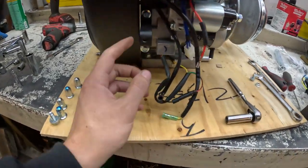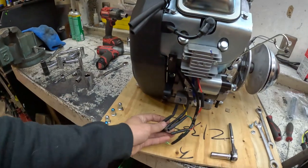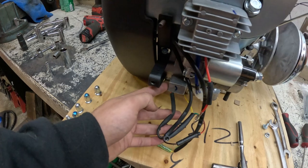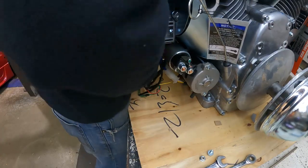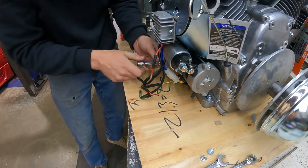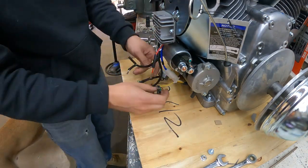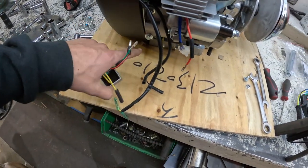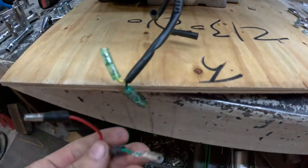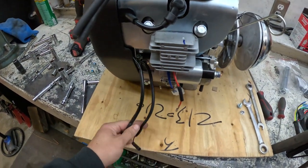The key box is off. Now there's a bracket that also needs to be removed. These bolts go back in and then we pull out the tip-over switch. The tip-over switch — connected by red, green, and yellow wires — is something you don't want on this motor for the golf cart, so we remove it and the bracket. Everything necessary is now off and we can start installing the new wiring harness.